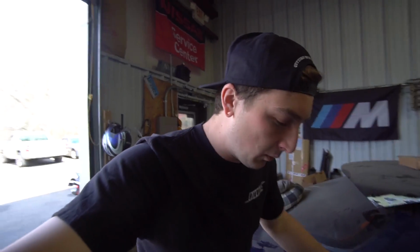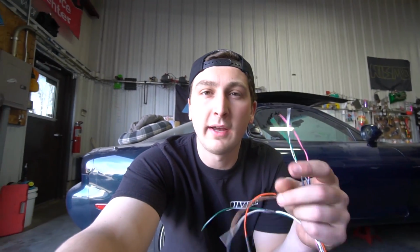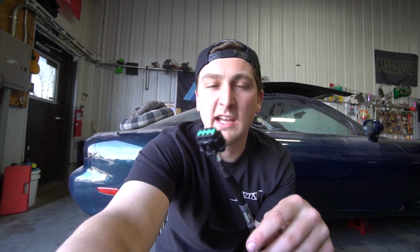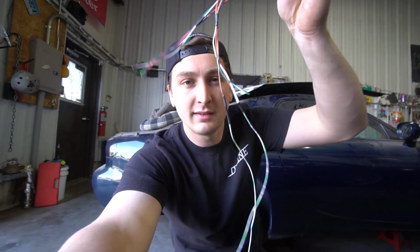It's annoying. So I'm just about to finish up the fan wiring and I'm so happy because it's taking forever. It's not hard, you just gotta run a lot of wires. What I'm really pumped about, which is not the coolest thing ever, but I'm stoked about it, is you can do high and low fan controllers on the ECU. So I can have one fan kick on at a lower temperature, and if it exceeds a certain temp, I can have the second fan kick on. There's no reason to run both fans and pull more amps than it needs to, so I thought it was pretty cool. The Wiring Specialties harness gave me an extra bank for extra pin outs and pin ins, and this way I'm gonna control the fans via the ECU.